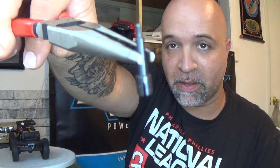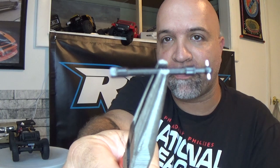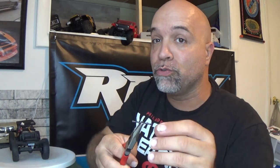Let's go over it again: to get better steering angle out of this thing you need a new servo, the SCX24 axle stubs for the left and right side, and a longer servo arm. The SCX24 dog bones will also work onto the stock Raycent. So: a new servo, those wheel stubs, and a longer servo arm to get better steering angle out of this thing.